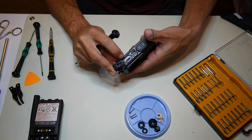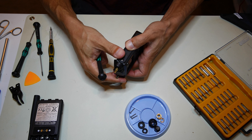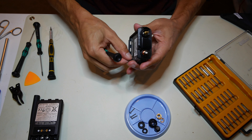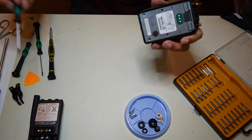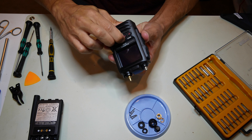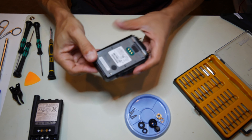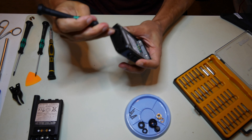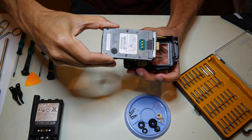The SD card will hang over the plastic a little bit, and if you try to press this case out you'll likely bust the connector. So if you're watching this video and thinking about doing this, go remove it from your radio now so you don't forget, because it's easy to apply some pressure and break it. Inside this screw hole it's threaded — you can put a slightly larger screw in there, though I couldn't find one small enough. So what I do is press on the buttons themselves, which pushes out the back case. You could press on the screen, but I didn't want to. Once you do that, the case starts to come out, and through the little vent holes in the bottom you can put a flathead and start to lift the case until you can pull it straight out.